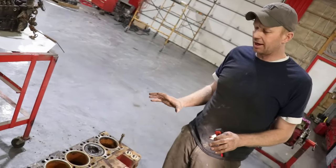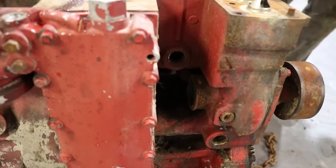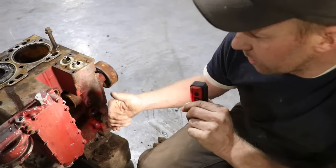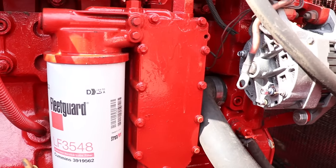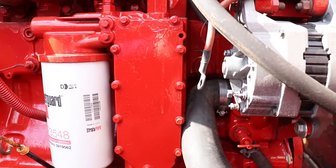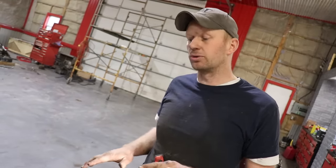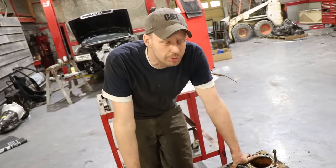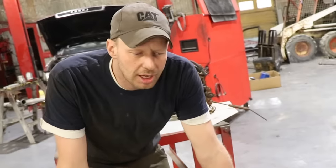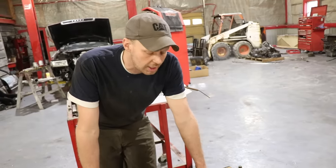As for the bare bones of the engine, there's really nothing wrong. I don't like how they put the exit from the water pump right up against the oil cooler — every radiator hose, even just to slip it on, is super difficult, and any 90-degree turn will really slow flow down. In the combines they had a cooling issue, and I don't understand why they couldn't have made a nice gradual turn rather than a sharp 90 coming out on an angle. I think that's only the agricultural ones that had a main issue with cooling — motorhomes going down the road don't generally have overheating issues. I have heard of exhaust manifolds cracking, and I believe there was an updated exhaust manifold, especially in the motorhomes, that didn't crack like the original ones did.